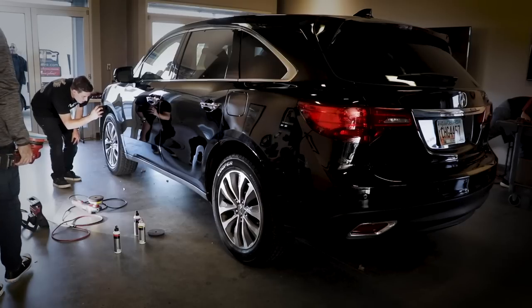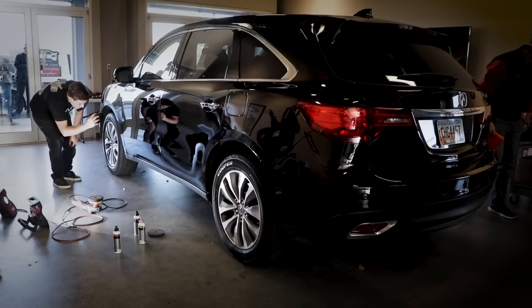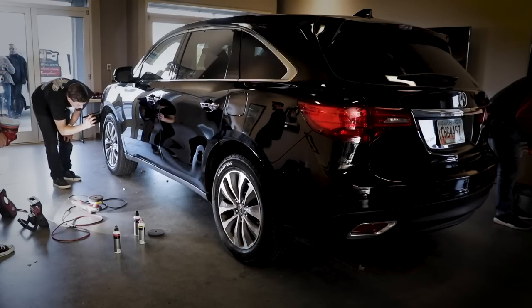Maybe after the first pass with a new pad, I would prime it one more time. But then after that, I'm just using the residuals that are left over. I'm just using leftovers because they're the most broken down abrasive. And by the way, the same rules apply. We're not breaking all of them. You want to use your Tornador gun? Blow out your pad between every 2x2 section.